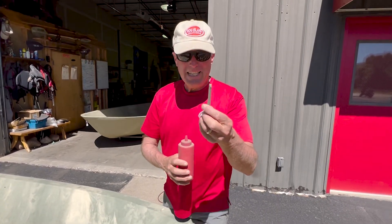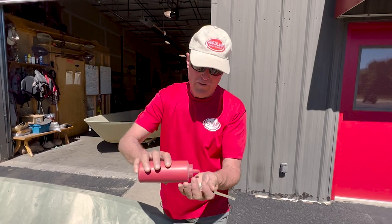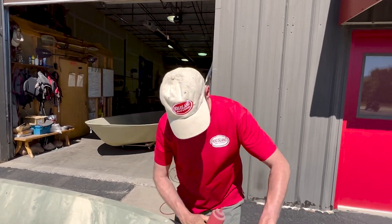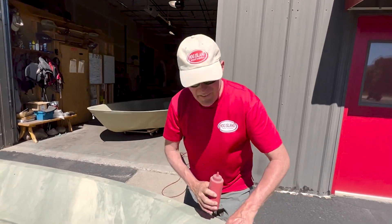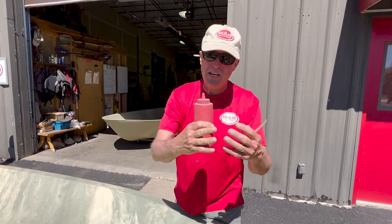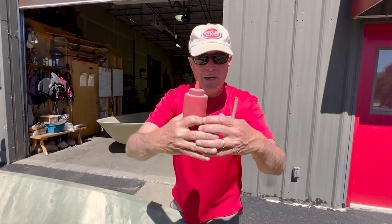When we're welding, we make the stick out of the same resin, or very similar — same polymers. We preheat them, bringing them just like in an oven to a liquid state, and then bring them back down. That's how polyethylene bonds: it gets hot to a certain degree, say 450 to 500 degrees, and then it's able to make a permanent bond.